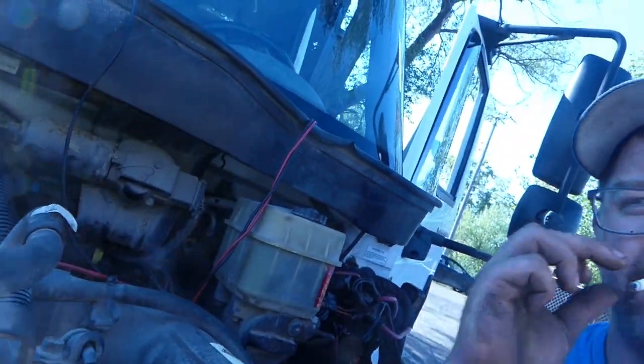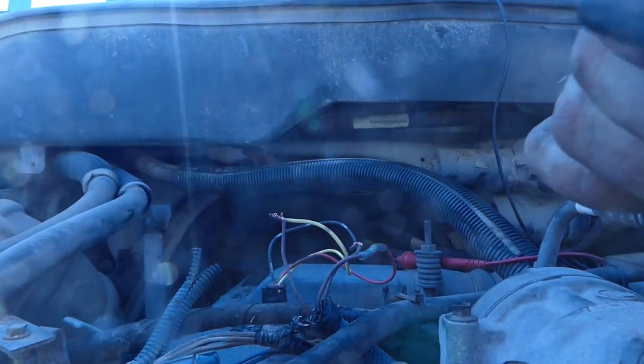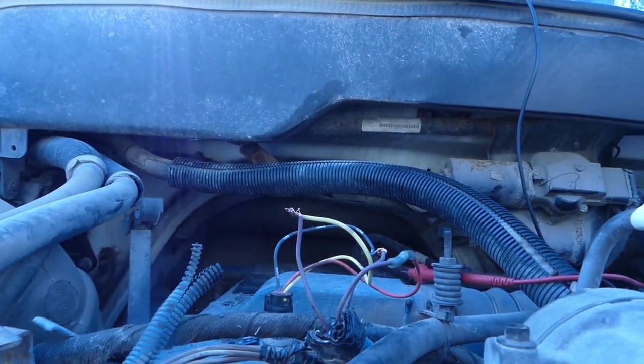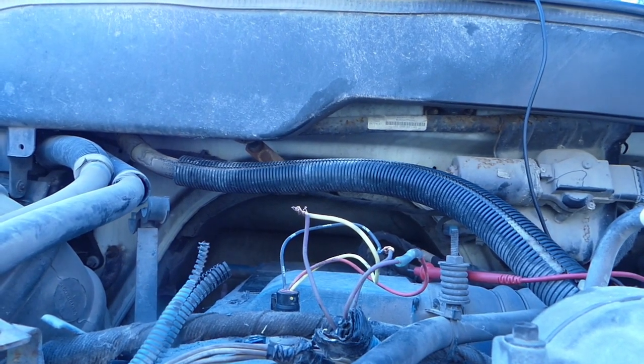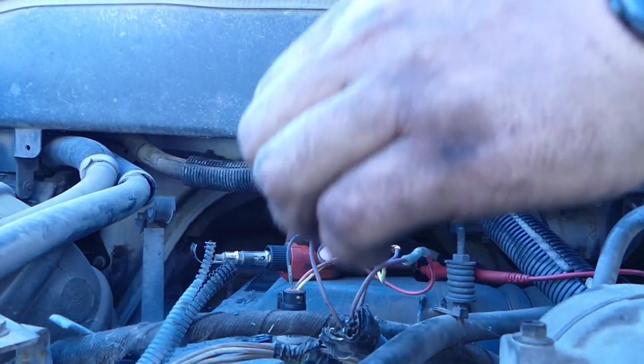Now, that was really, really nice of them, and it was actually very, very efficient. I had a PDF with everything that I needed to do, and it was exactly what I needed. So I ended up finding, I don't know what I show you here, but I'm just gonna tell you exactly what I found. The wire numbers were: your signal ground was 97 DC, your voltage reference was 97 CY, and 97 AY is the actual signal.